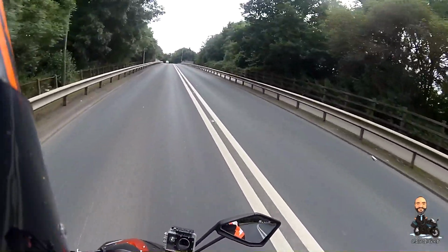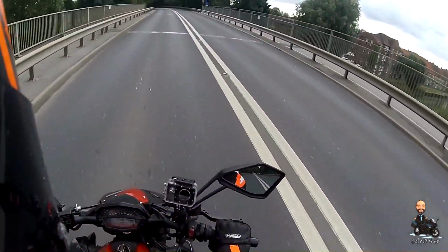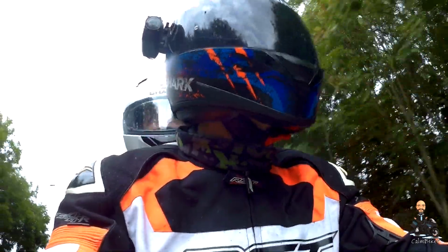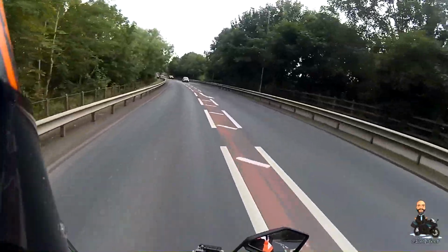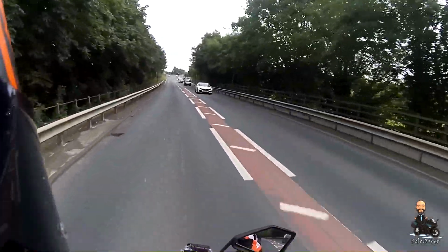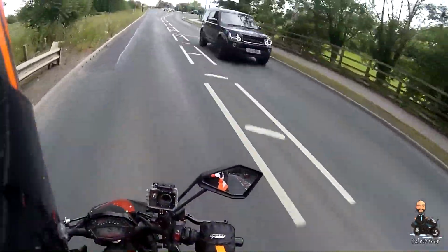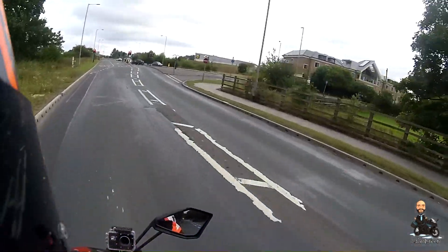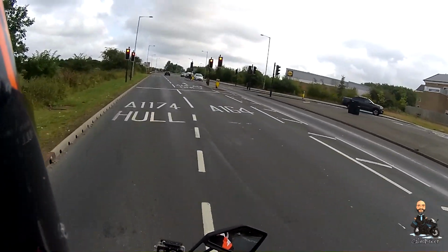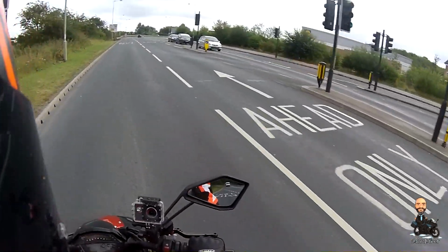And then I had the sprocket cover off, so I could have a look at the front sprocket, which was buried in a mound of chain wax. It's that usual thing where behind the cover there's about an inch thick of black goo. But the sprocket itself's in good condition, no hooking, no wearing that I can see. So it's a bit of a mystery, so I'm kind of hoping that in my tinkering yesterday I might have found it. But I'll only find out by riding it today, and I probably on this little ride won't get a chance to hear it much anyway.